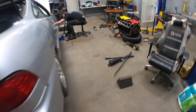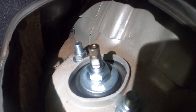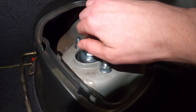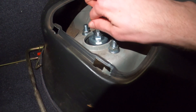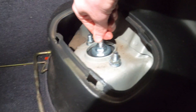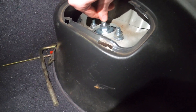Let me show you guys how to do the dampening now - it's really simple. This little knob on top has a red piece on it if you're getting MaxSpeeding Rods coilovers. You just turn it all the way to the left first, and then count the clicks: 1, 2, 3... all the way to 24. So there are 24 clicks total. You do 12 - right in the middle - at first. Then if you really want to get into the tuning aspect you can do that later.